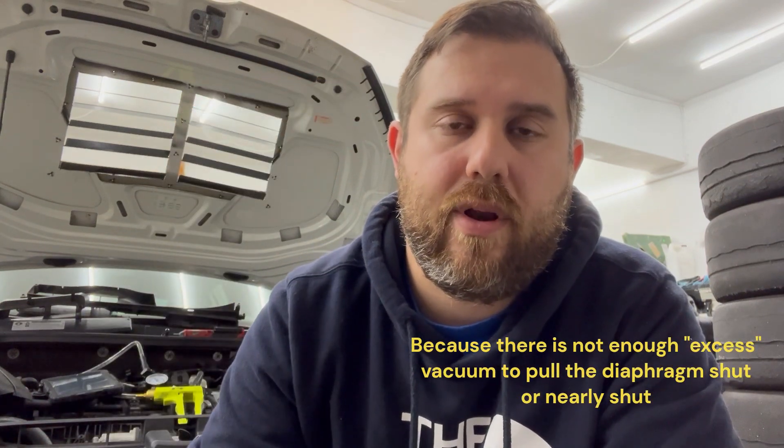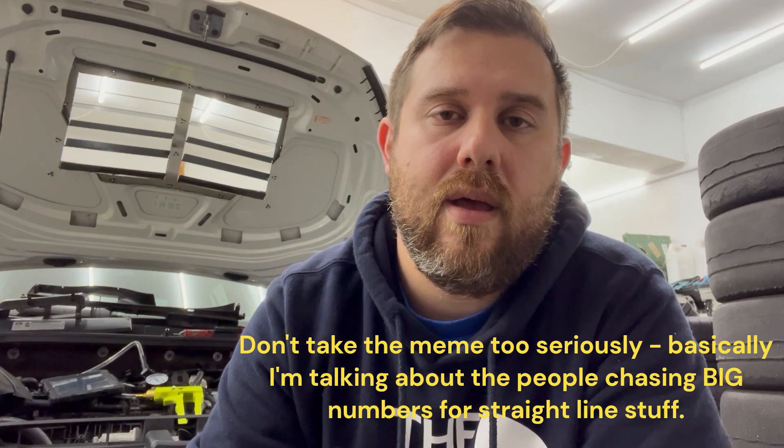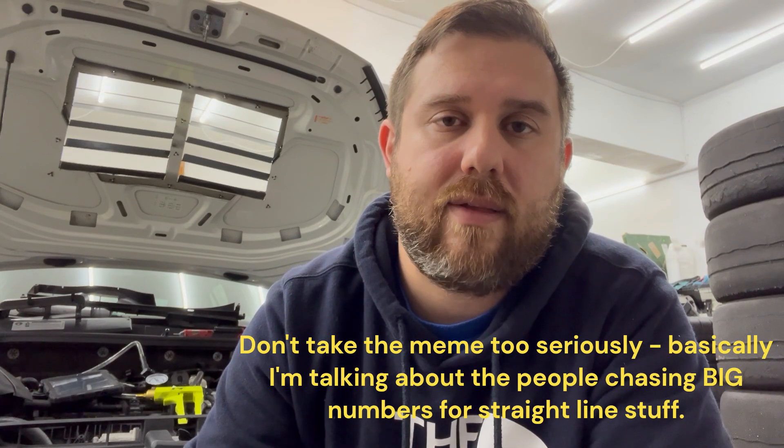After some testing — putting the gauge on my car and a few other people's cars — basically changing the turbo inlet pipe causes a huge drop in vacuum at the PCV hose. And that is what seems to be screwing up the way that the OEM PCV works. I don't think that it's a problem that really shows up on the street too much, unless it's maybe extreme cases. But for the people who track their cars, which is what my original goal was to figure out — how to get one of these things to live on track — it looks like it's pretty vital.